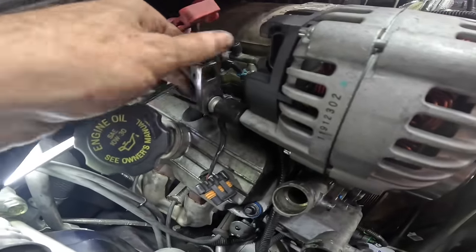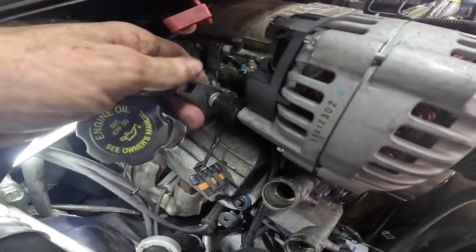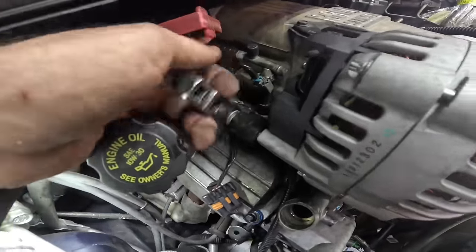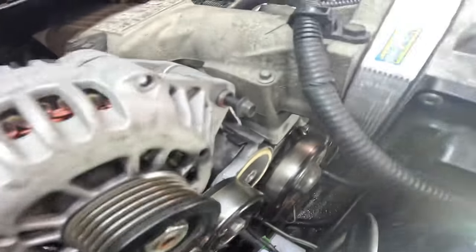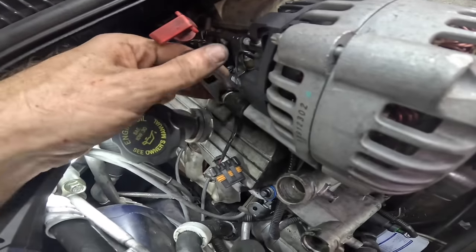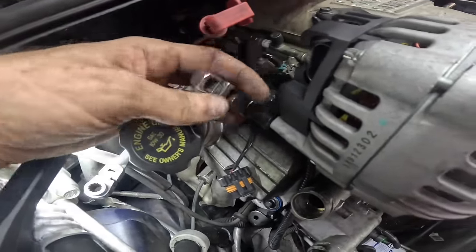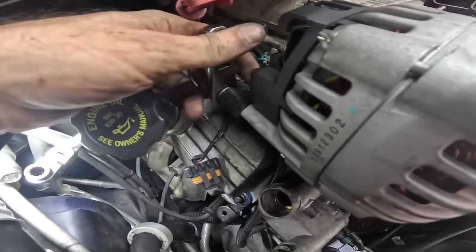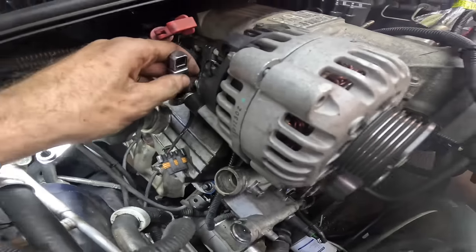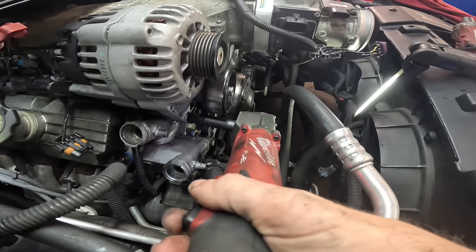So what I wish to do here is run this bolt down all the way. I mean, not tight just yet, but I want to take all the slack out of it. So once that one is located, I'll tighten this one and this one back up. Then we'll tighten down this piece of the bracket here. Then we'll apply final torque to this fastener that I'm working on right now. It's one of those critical thinking moments you have to take into consideration when dealing with loosely fitting parts with loose tolerances. Okay, 13 for that bottom bolt.